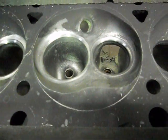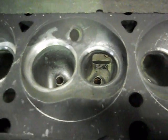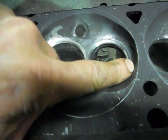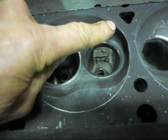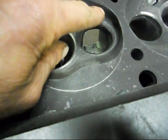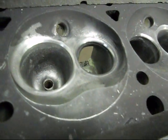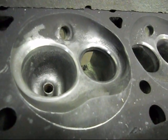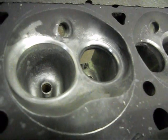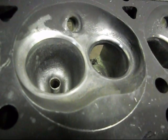What I'm going to do is actually relieve the side of the combustion chamber out to the actual edge of the head gasket, so it's nice and blueprinted — everyone's exactly the same. And also by taking a bit out here, we do sacrifice a little bit in compression which we'll make up in other areas. That's not a problem, but there's an immense improvement made in flow.